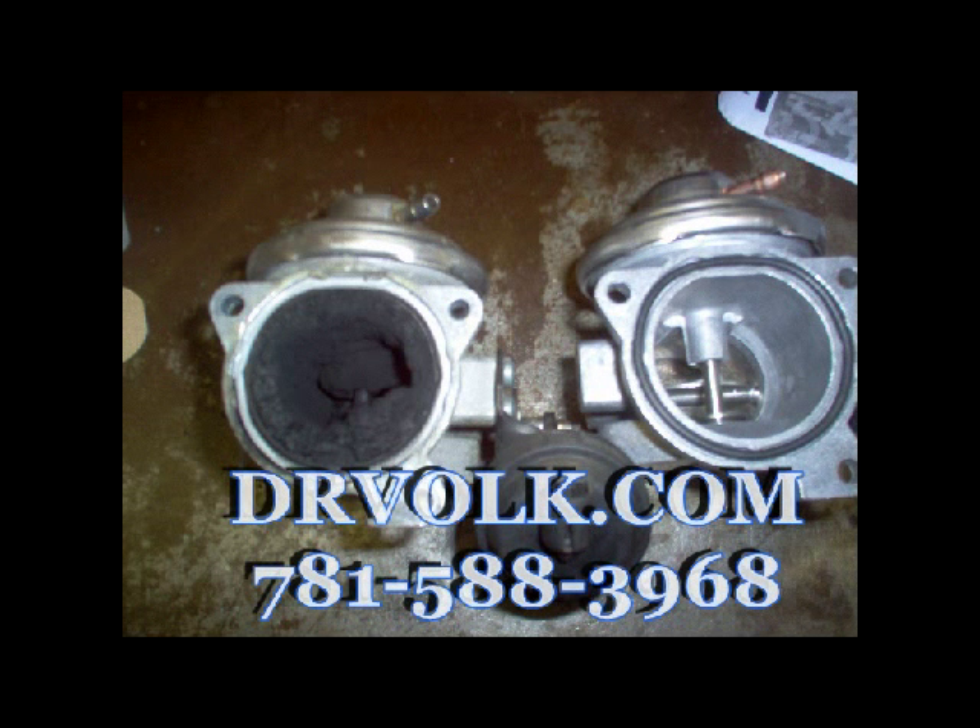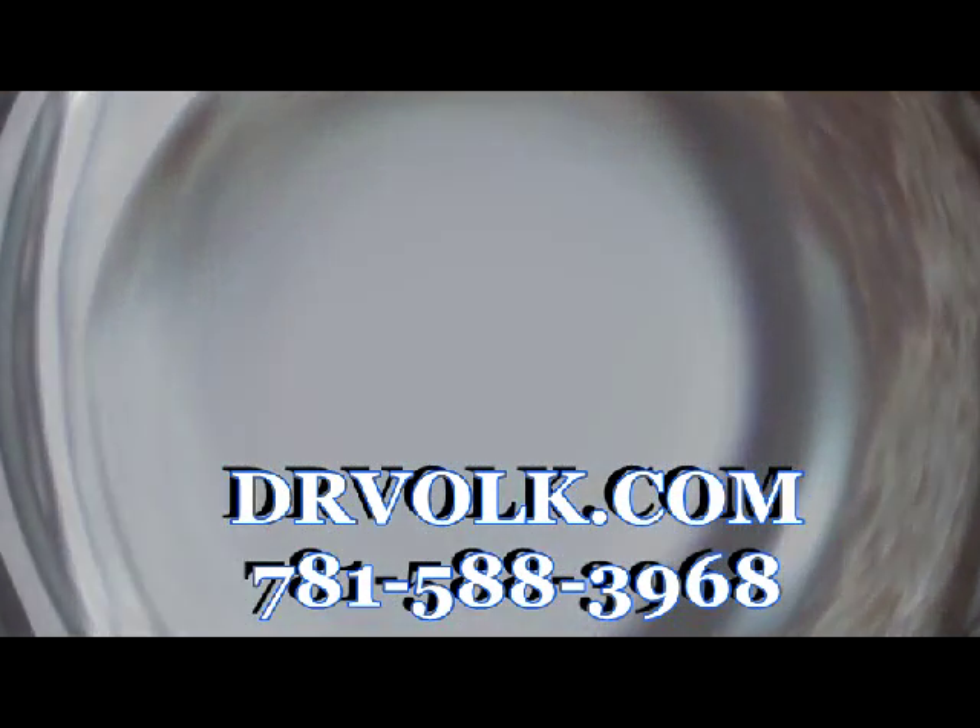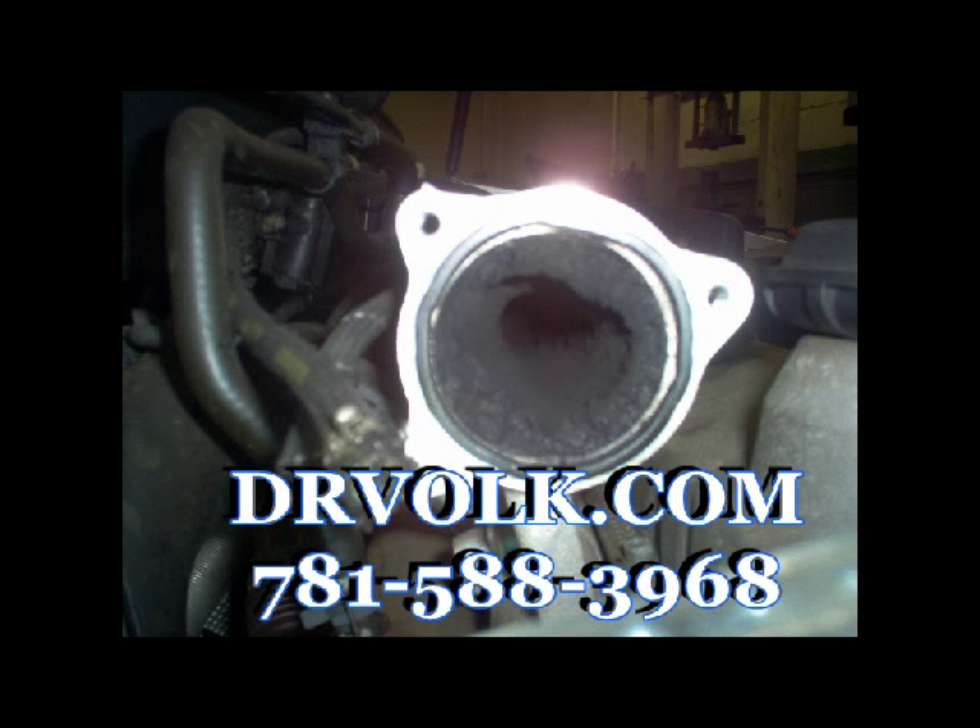These pictures show what EGR valves look like before and after I clean them. After they're cleaned, they're tested to make sure the diaphragms work correctly. This is a dirty, messy job — most places just replace the EGR valve at $300 a pop. Here's an intake on a Jetta that's almost down to nothing; the one on the Beetle was even worse. You can see the difference between breathing through a two-and-a-quarter inch diameter hole down to less than a half inch. It kills your performance and mileage. After I did this service, the car started up instantly.